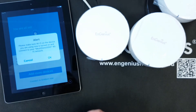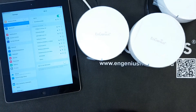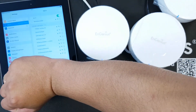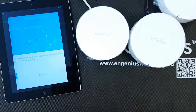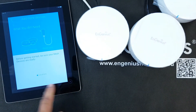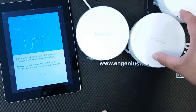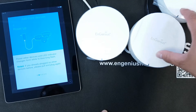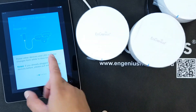I press to add more devices, and an alert appears: please make sure Wi-Fi on this device is turned on and connect to your MESH demo SSID Wi-Fi network. Let's do that — find MESH demo SSID and connect. Since I prepared this in advance, I don't need to enter the password, but normally you would. The wizard then shows what you need to add more devices. There is a certain time window during which the blue long flash is blinking — this is the status where the router can receive configuration data — and it's still on, so we're fine.